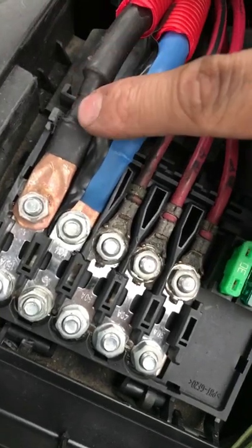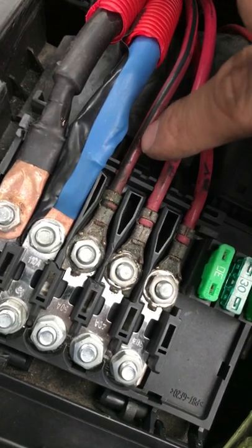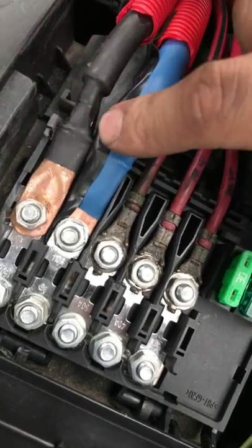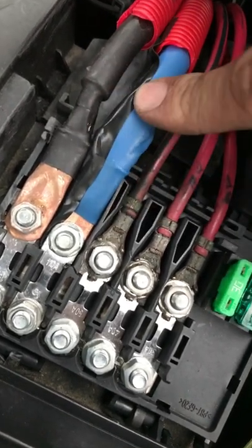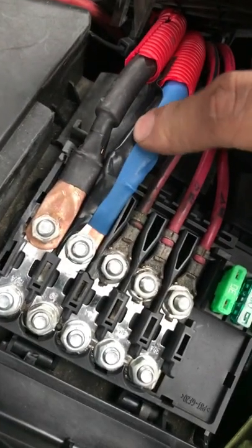This whole part was melting, and you can see it melted completely through — went through two boxes. The original cables on these I believe were a 6-gauge, a little bigger than what I had. I put 4-gauge cable on both of them to ensure the cable will have enough strength for the amount of power coming in from the alternator and going into the cabin, because I have HID headlights which make them really bright.